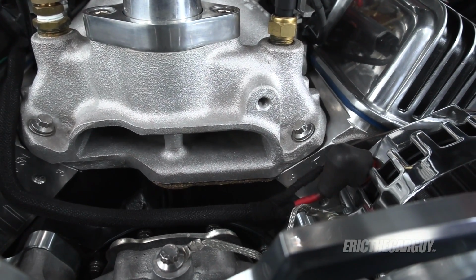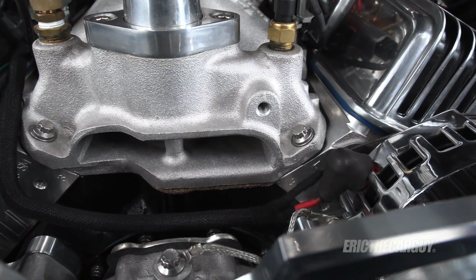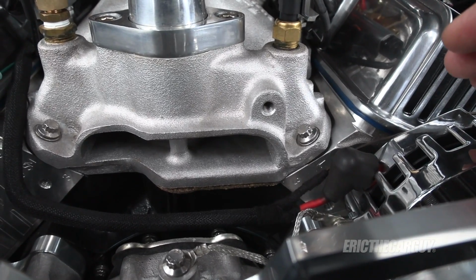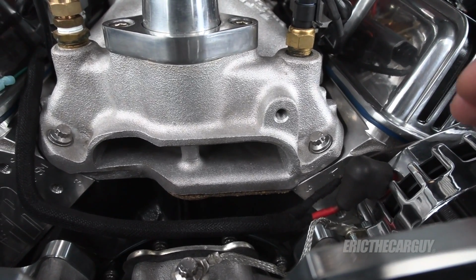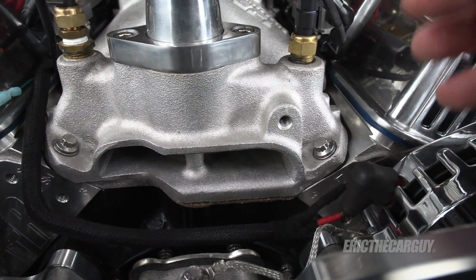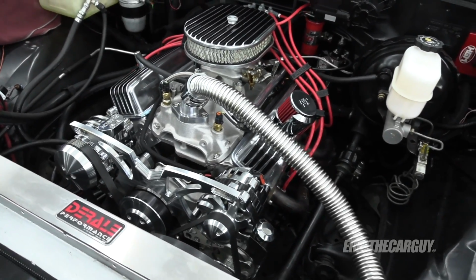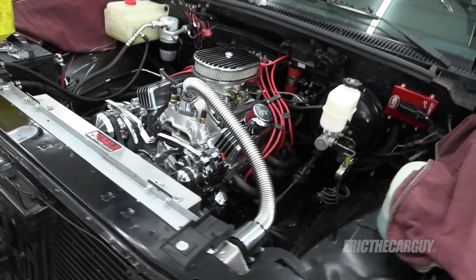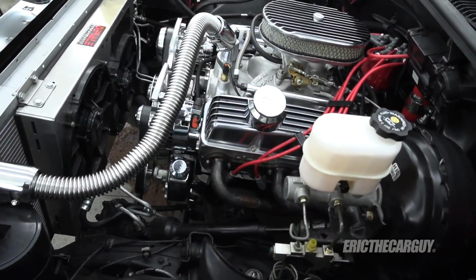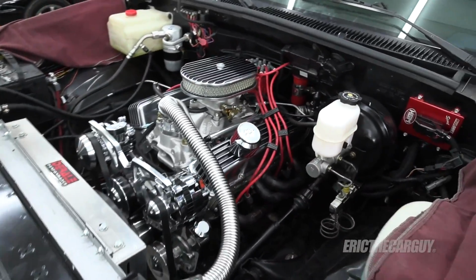This was not done in my case. Now, like I said, there's debate online whether or not this needs to be done. Thankfully, this is aluminum and it's stretched into place and I don't have any leaks here, but I'm mentioning this now in case you are doing something like that, that this is something you should watch out for, because in addition to coolant leaks, this could also cause vacuum leaks at the intake runners. If I have to, I'll go back in and put a thicker gasket in, like find the best gasket I can find. But for now, I'm full of coolant, full of oil.